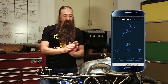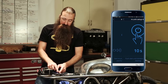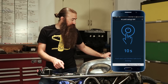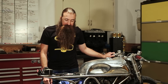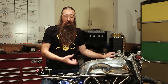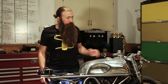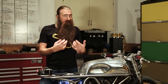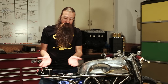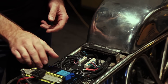If you heard the horn honk, it was wrong — try again. The blinkers flashed, which confirms we got it right. Next, push the start button until the blinkers take turns flashing — this is a 10-second press and hold on the start button. If you missed the setup and didn't get it in that first second, pushing the start button will engage the starter. In this case I'm pressing and holding the start button but nothing is happening, which means I got it right. You can see the blinkers are alternately flashing.